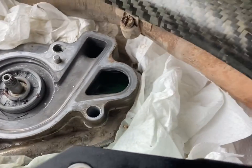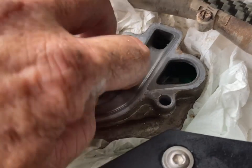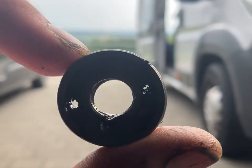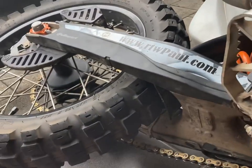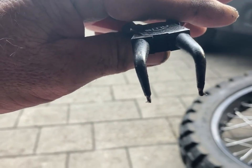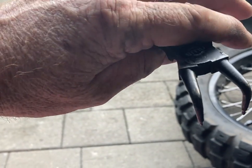Another method is what I did — you can see there are two holes in it. I drilled the two holes in it and then used a pair of retaining ring pliers. Tap those into place and then pull it out with that. So that's out.